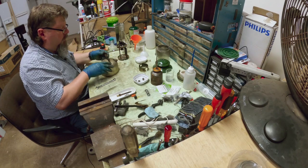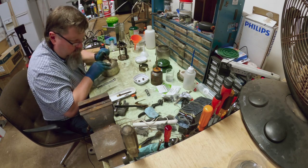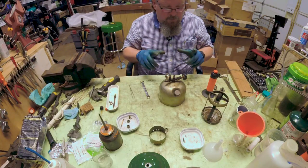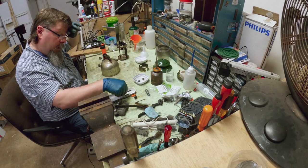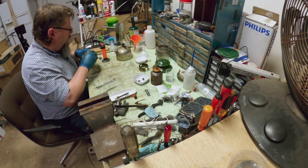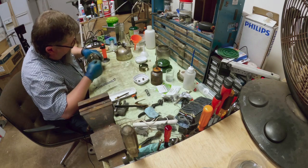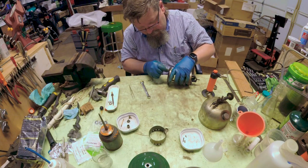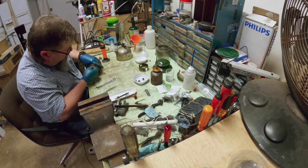We're going to close this up and get some pumps in here — see if we get airflow out of this. Moment of truth — oh yeah, plenty of flow. So we know we've got a blocked generator and a blocked air tube. Let's work on this air tube a little bit. I've got a little wire I'm just going to poke in here. This is what we talk about when we say check to make sure your air tubes are not blocked with bug scuzz — this one definitely was.